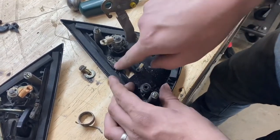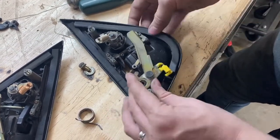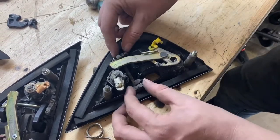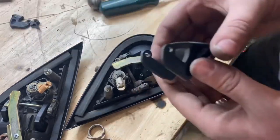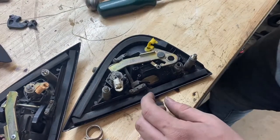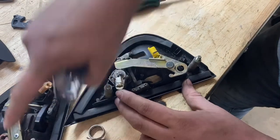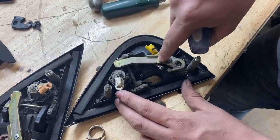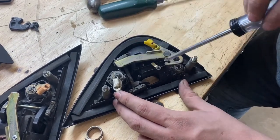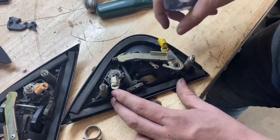You don't have to take it apart from the rest of the door handle, but I'm going to just to make it easier. It's a smaller set of four Phillips screws on both sides to retain the rod that goes across inside all these holes here and on this latch piece. Once it's all out of the way I'll take this piece, measure the same as I had for the other one, mark a spot on this piece, go ahead and drill it, pop our rivet in, grind down the metal piece inside for clearance, and then put it back in the car.